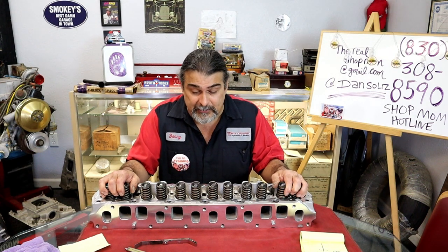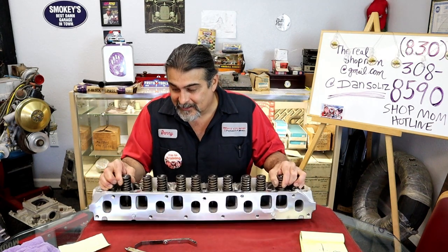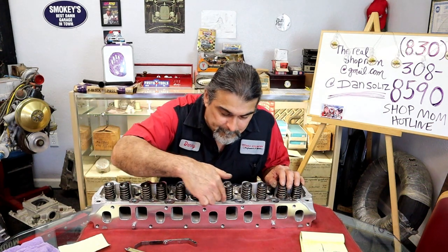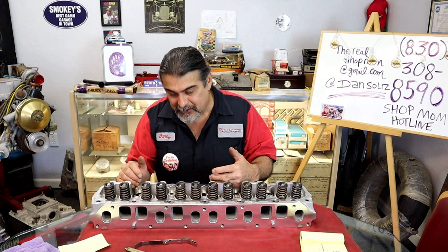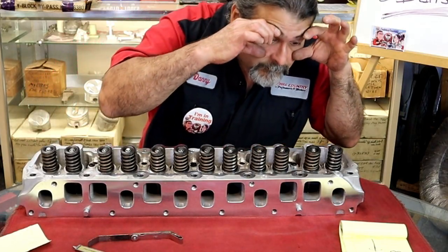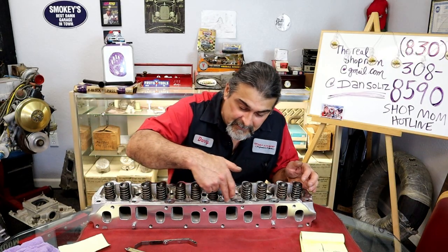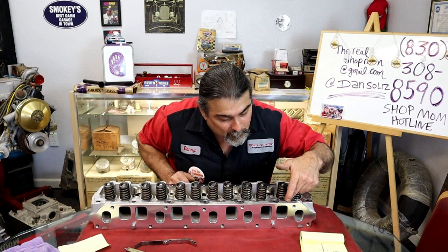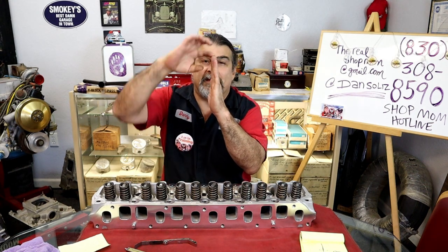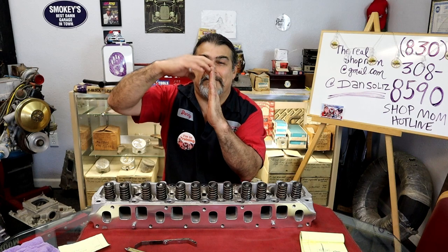If not, and we're going to have to either change valves or seats, I don't know really what he's going to do. And I've already spent a little time when we unboxed it. They use a CNC program to come around here, and it's such a new head that no one has taken the time to go, oh, we need to move the CNC program over slightly. So when it came in here and it cut the valve cover pad, they actually left a wall of aluminum. So it had a casting and they cut the valve cover pad and they left this aluminum wall there. Looking at the bolt hole, it looks to me like the valve cover gasket and the valve cover are going to hit that lip.